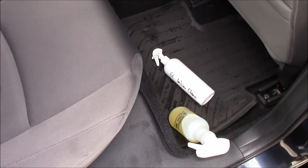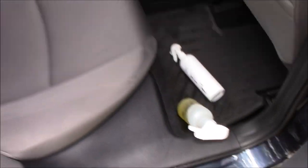Now, what I was mentioning — if you're going to do carpets, use a hard bristle brush. Spray the cleaner on the carpet, use the brush to break it up a little bit, give it a few more sprays with the cleaner, then go behind it with a damp microfiber towel, massaging all the dirt and cleaner out of the carpet.